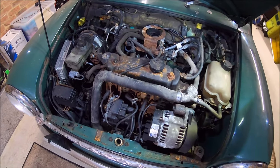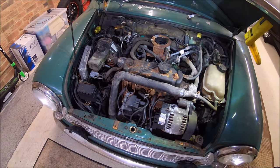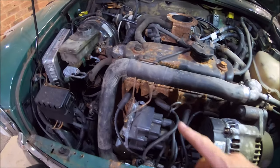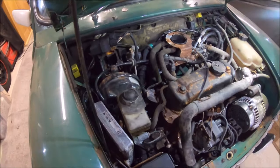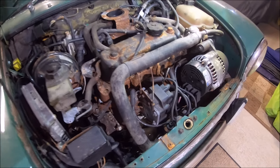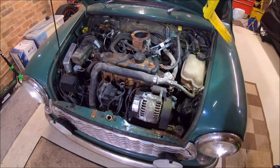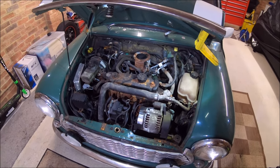The engine runs — you heard it running in the last update. Still got to free off the clutch, and I'm going to fit the drive shaft in a moment. But just look how rusty it is — it didn't have the bonnet on it when I went to pick it up, so I assume it's been left with the bonnet off and water has just been dripping onto the engine. That is very, very rusty. There also seem to be a few electrical gremlins — the battery light stays on when you connect the battery up.